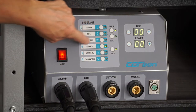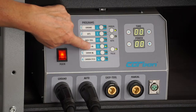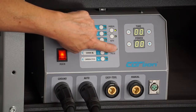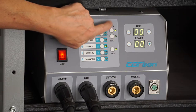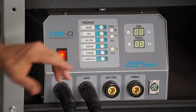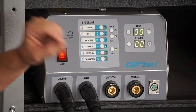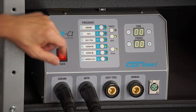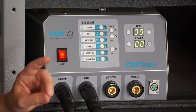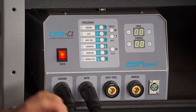The other item that this will do is shrinking on steel. If we highlight shrinking, FE stands for iron or steel. Pulse is lit up. Manual is lit up — we want to put this onto auto. Pulse means that when we go to shrink, it's going to fire three times in succession. I recommend taking it off pulse and starting with it one time first, to get used to how the shrinking tool works.